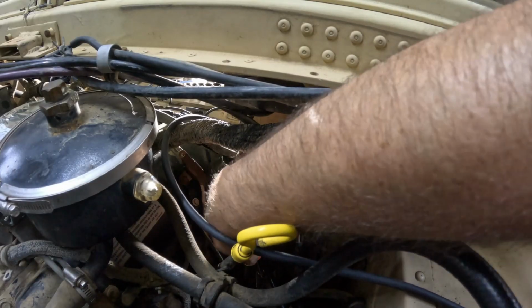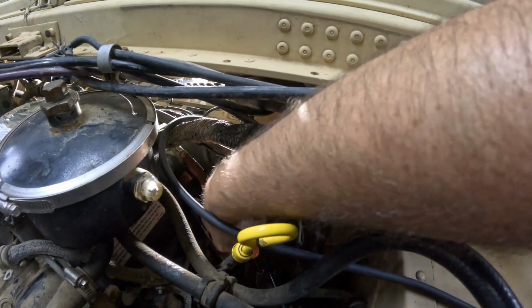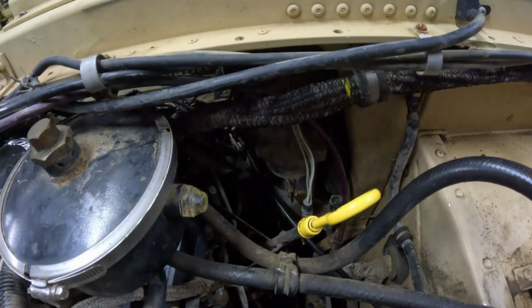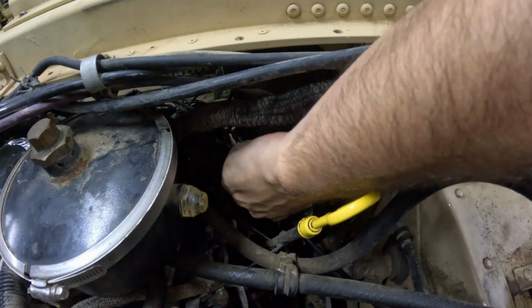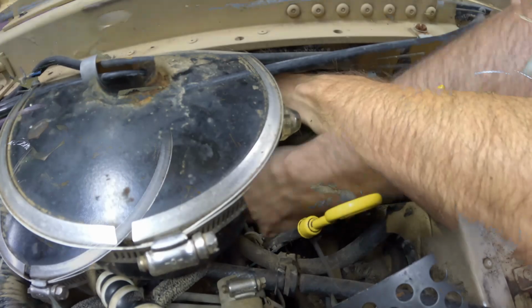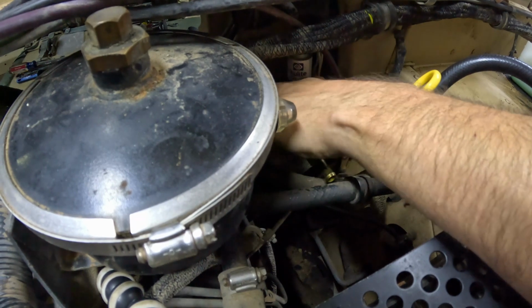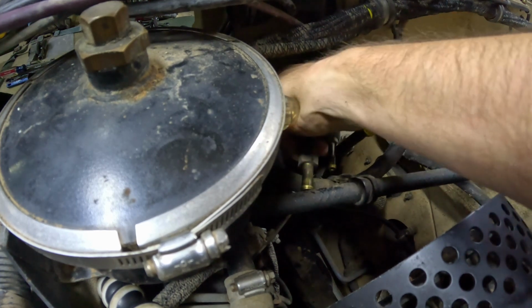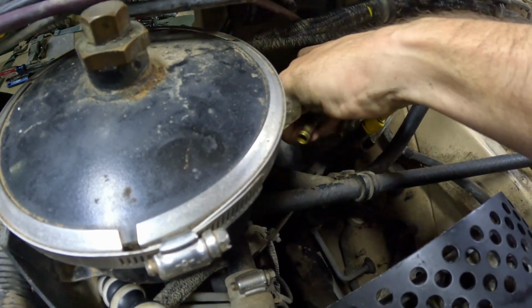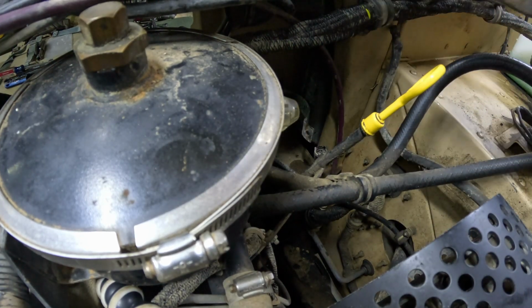Everything's super sharp too. I mean, I get needing to put a fuel filter in, but it's one of the weirdest places you could put it. It's not very accessible. Removing the fuel filter housing, it's held with a little clamp here. It takes a 7/16. I think this clamshell just opens up and I can pull the filter housing forward. At least that's my hope. Looks to be the case. Alright, here we go. Dump fuel all over myself.